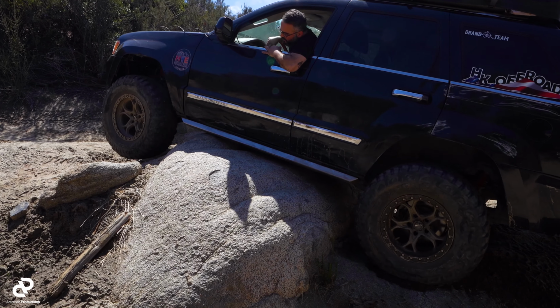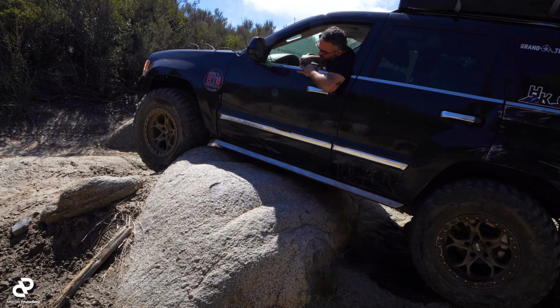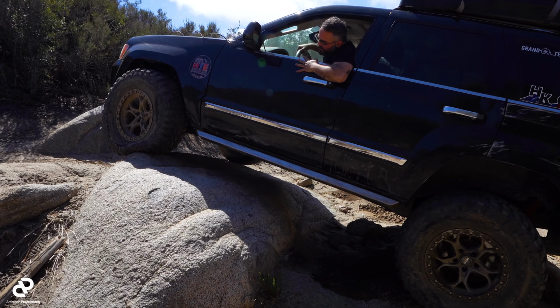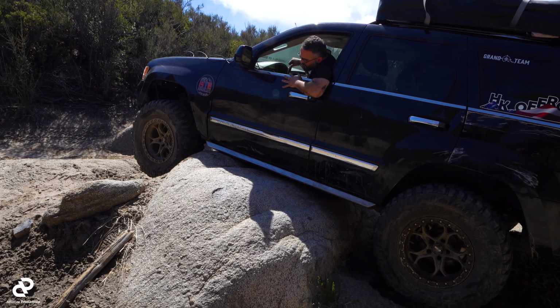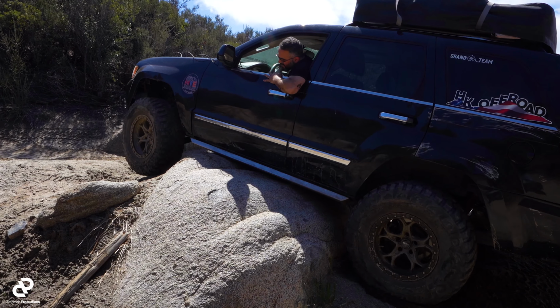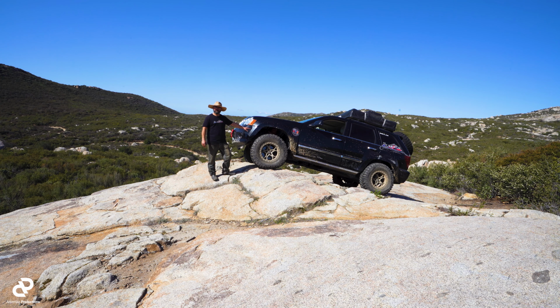So this thing is mounted to the vehicle on the pinch seam using 6 bolts, and we've tapped straight into the slider. So there's not additional brackets that we need to weld on and anything like that. It's mounted solid from there. And then you've got 3 frame rails from the front to the center to the rear, mounting to the frame rails. And those use 6 mounting points on the bottom.